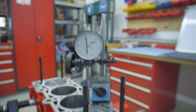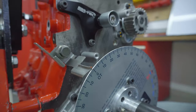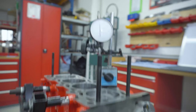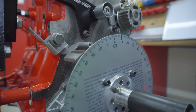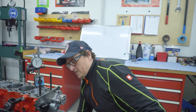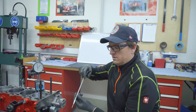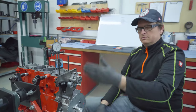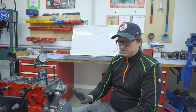Now we have to go back to TDC. We go back, then again one turn on the gauge, and we are at 34. For me this is perfect. I'll tighten the second bolt, tighten this bolt one more time, and then I'll double check once again. The TDC setup is now perfect and done.